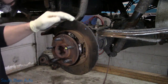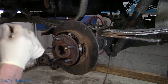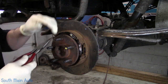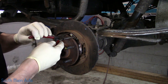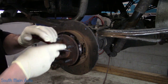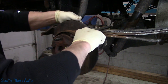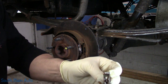We'll leave our adjuster in for right now. We've got to pull the nails out. These are a little tricky. I usually shove them towards the nail and then push in on it a little bit to make sure it's freed up. Then I'll take and push in on it with the pliers and push the nail towards the keyhole — towards the open spot. That's kind of one swift move. I'll pull the nail out from the backside — that's what it looks like when they go in.